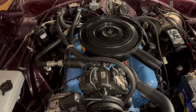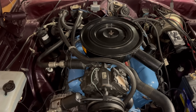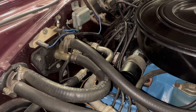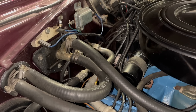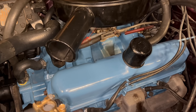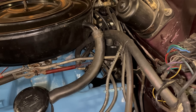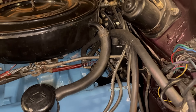About a month ago, I did another video on this car in which Tom Hergert and I completely restored the top end of this 318. Looks great. During the course of filming the video, I slightly forgot about something which several commenters reminded me about later: this distributor in this engine has no functioning springs, and it's stuck in the all-party-all-the-time mode. It's really silly because I was trying to get this thing tuned and running correctly at the end of that video, and it wasn't cooperating. So many things are making sense now. This thing will never run right with an effectively locked-out distributor, so today we're gonna fix that.